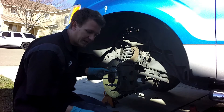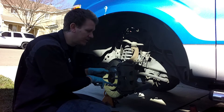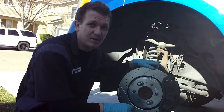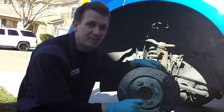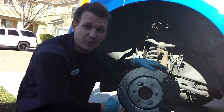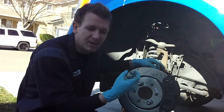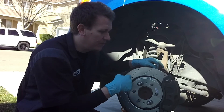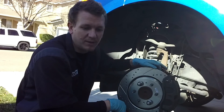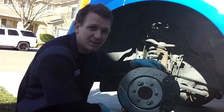Put the wheel on and torque down your lug nuts too — I think they torque down to 110 pounds on this one. That's it, these brakes are super simple. Make sure you torque everything down. On the rears, don't go too tight on that 10 millimeter bolt — I wouldn't imagine more than 24 foot-pounds on that. So that's it for these brakes, front and rears. Hopefully this helps you out. Make sure you check below for the parts needed. Like, subscribe, and share, and I'll see you on the next one.